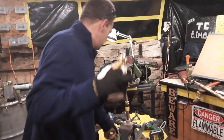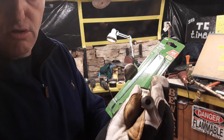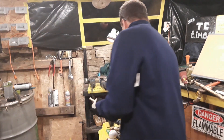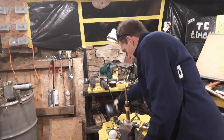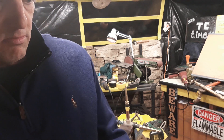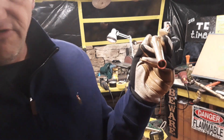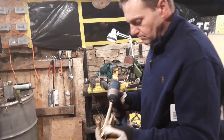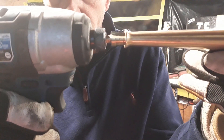That's what it looks like coming right out of the package — got it at Ace Hardware. Brand new out of the package, that's what the hole looks like. That's too small. So the first thing we're going to do is take a step bit — it's marked — you're going to put it in a vise, hit that hole right in the middle, and flare it out. You'll notice that's a flared bit — flare it out. That's how deep you want to go.